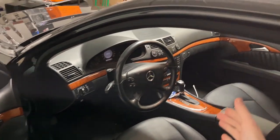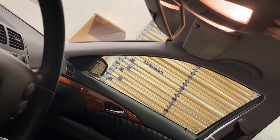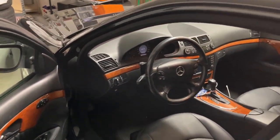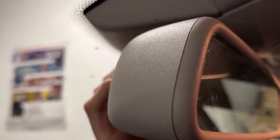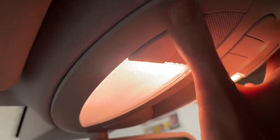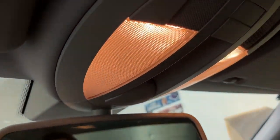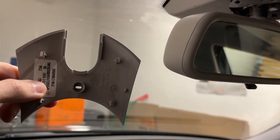The pressing part is over. I'm really looking forward to changing those mirror lights into LEDs because they look really dull. I watched a video on how to do it — basically you remove this piece here, then that one, then pull the outer trim off, then pull down on the mirror and that releases the whole unit. Hopefully I can install the LEDs. This outer piece came off with relative ease — let's proceed.